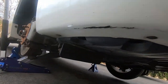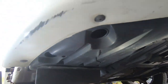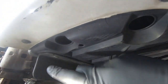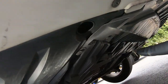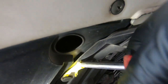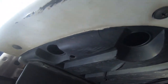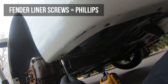Under the car now, under the front bumper. To fully remove the inner fender liner, there are three Phillips screws retaining the bumper to the fender liner and one more clip just like the other three. Pop the clip out, then zip out the three Phillips with an impact — you can use a screwdriver, impact drill, whatever works for you.